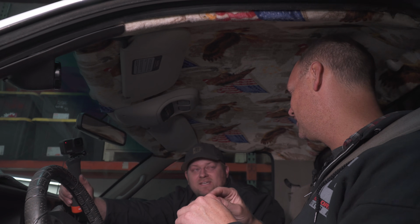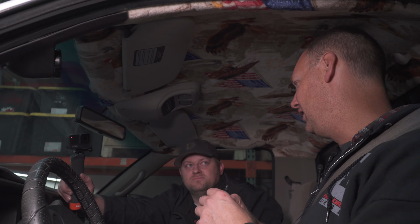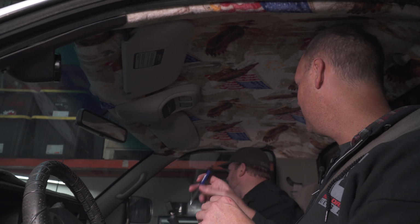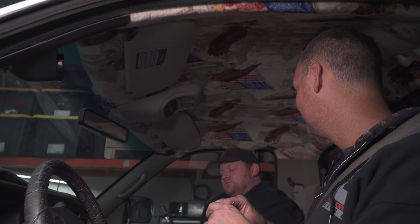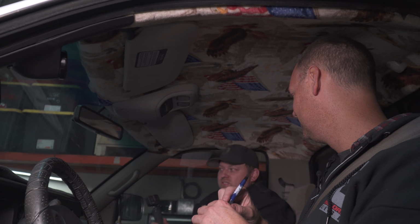432 is peak power. So the next turbo, let's just move right on, is the K27. Your honest opinion now, is it going to do better or worse than this turbo? I think it does better. It's got a little bit bigger inducer. I think it's a 450. I think we're going to pick up 20, 30 horse with that guy. What do you think? I mean, our best was 432, but that was the second run on the heat soak, so the next one will be pretty cool.